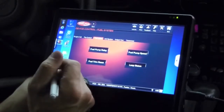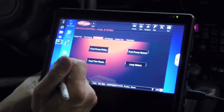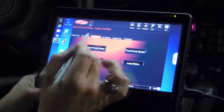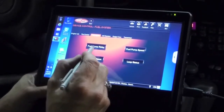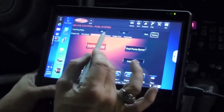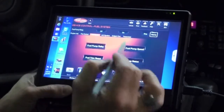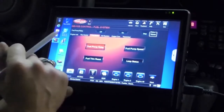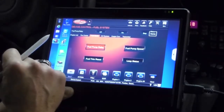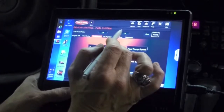For the sake of discussion, let's say this vehicle was brought into the shop because it wouldn't start, and I'm suspecting a problem with the fuel pump. If I go into fuel system and click on fuel pump relay, I've got the selections of on and off. When I select on, I'm going to listen to see if I can hear that fuel pump — which is located in the fuel tank on this vehicle — operating.